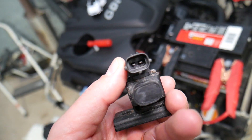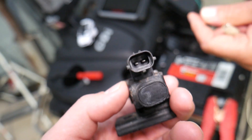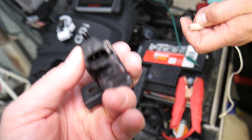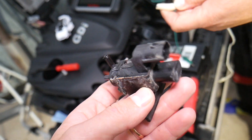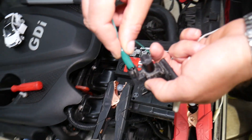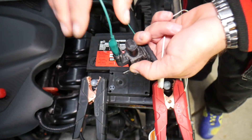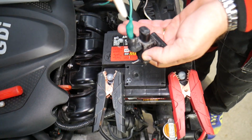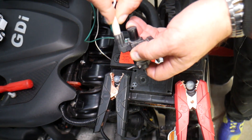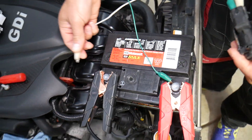To test the solenoid, it has two wires — it doesn't matter which way you put positive and negative, you can switch them. But if you touch the two wires together while connected to a 12-volt supply, you will burn it and need to replace it for sure. Use alligator clips to make the job a little safer. We use them all the time — we'll put a link in the description where you can get some.